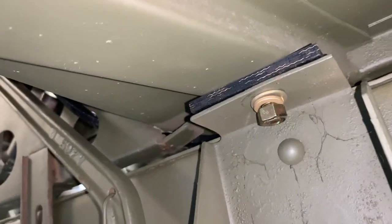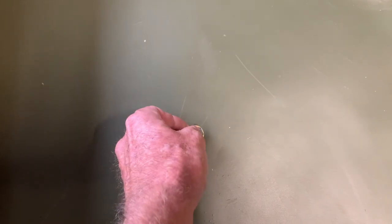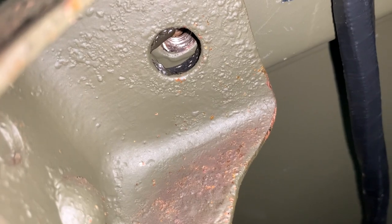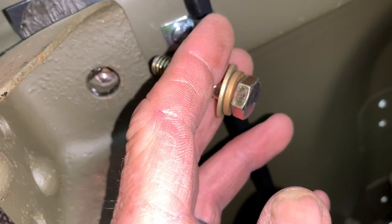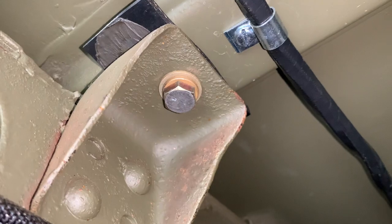Both of those locations will be fastened on the underneath side of the frame on this large bracket. I've got a lock washer and a flat washer and a nut installed. I'm not going to tighten anything up just yet — just finger tight for the time being. The third bolt to be installed is 3/8-16 by 2 inches long, and is installed in the hole directly underneath the passenger seat on the floor. On this side we've got the lock washer, flat washer, and nut, and on the opposite side — which is nearly where your fuel line comes through the bottom of the tub to meet the gas tank — you'll notice this pre-drilled and tapped hole in the crossmember. The size of this bolt is 3/8-16 by 1-1/4 inch, with flat washer, lock washer, and nut installed. If you remember from the other videos, that's where I had the spot where the bolt had broken off and I had to drill and re-tap it, but it's all secure and nice now.